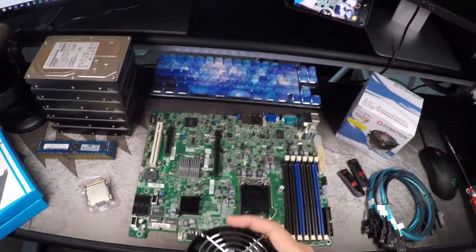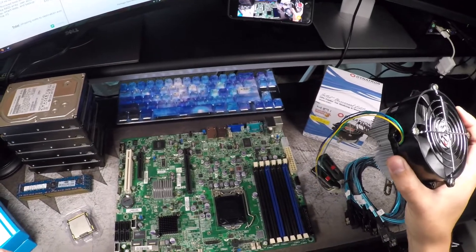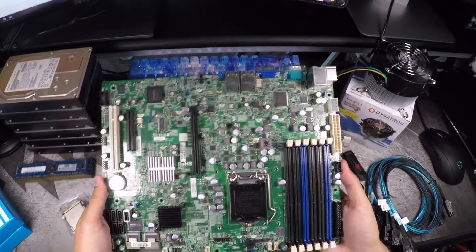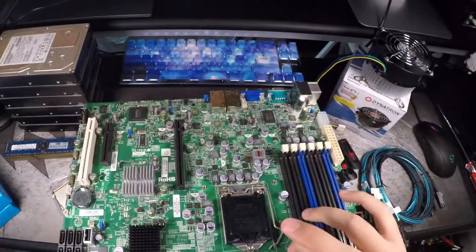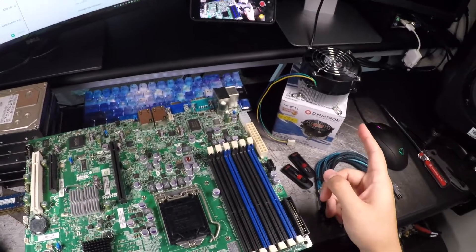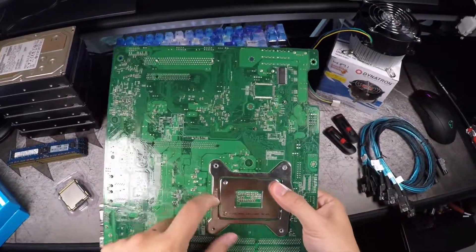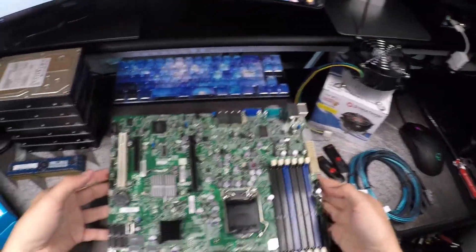The CPU cooler is a different model than the one I recommended in the build guide. The one in the build guide was a standard i5/i7 CPU cooler with pushpins, and unfortunately this board has a backplate that is pretty much super glued on. That means you can't use pushpin-style coolers without taking the backplate off, and I wasn't going to bother with that. So I got this cooler — it was only $25 on Amazon — it's actually a little bit nicer, but a bit more expensive. It mounts right up to this backplate without any modification. You can tell this thing's pretty heavy-duty; I'm not going to risk damaging the board just to get the backplate off.